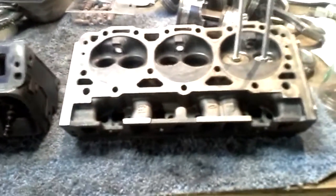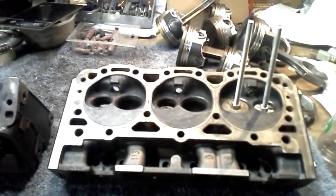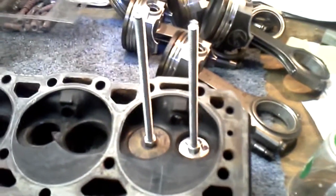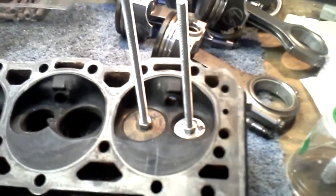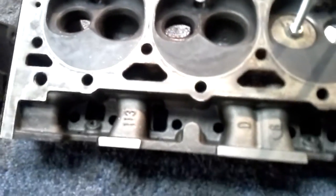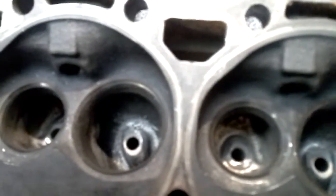This is a little bit of work I've been doing on the cylinder heads — kind of building up what I call the bowl or throat. How big you cut your throat or your bowl underneath your valve seats has a lot to do with what kind of flow you can get, and the quality of the blending from that cut into your actual port is super important. I've set up these as cutting guides so as I'm porting I can get everything to match both sides, and make sure it's as round as possible from the seat in. You can see some of the rough cut I've done on the guides — these are nowhere near finished.